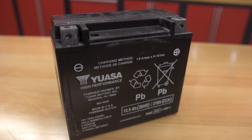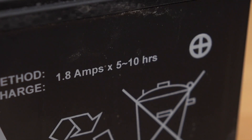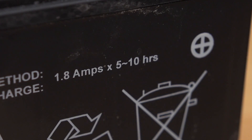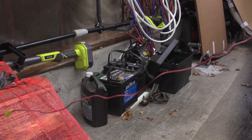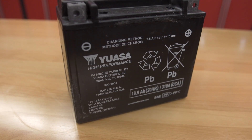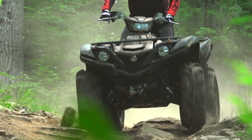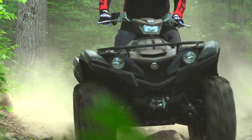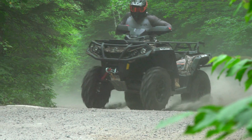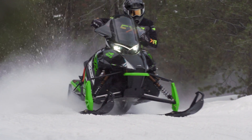In most cases, the parts store battery you just purchased with the battery acid already installed has been subjected to a quick fill-up and only allowed a short absorption time, then given a high-amperage charge to get it up to working voltage level. Here's the problem: following this process has already caused irreparable damage to the lead plates inside that brand new battery. When we say irreparable, we mean warped or damaged plates, meaning the battery's ability to deliver max cranking amps has already been compromised.